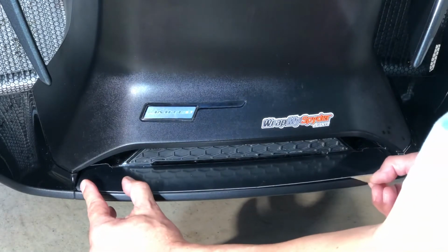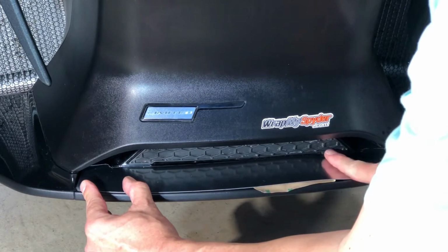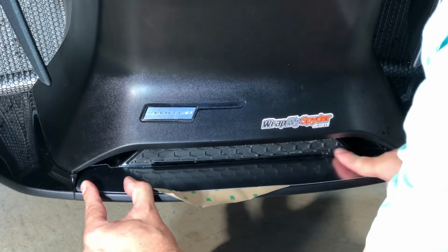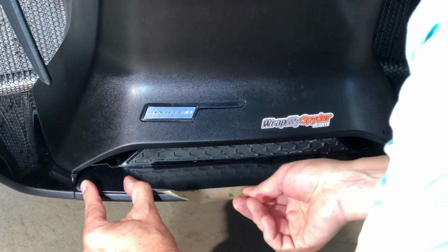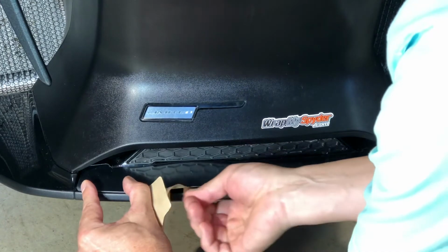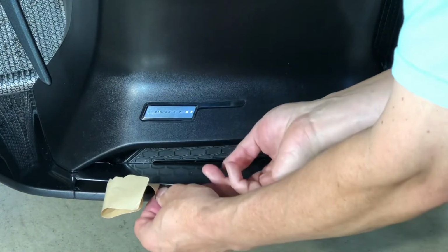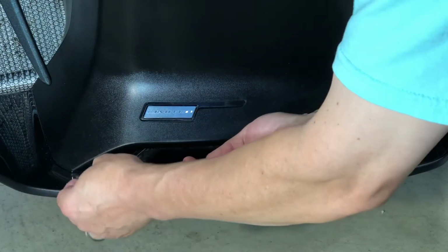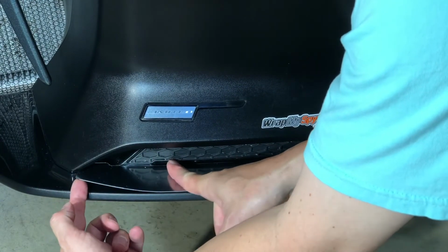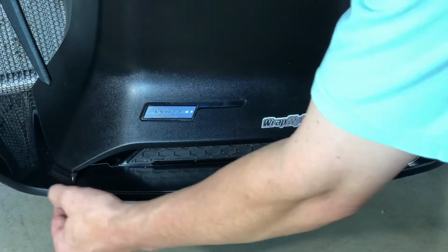And then we're going to bring that adhesive out. Again, pushing it down as we go, slowly moving across the front of the panel. That's going to help so that you don't have any air bubbles and the panel's going to lay nice and flat. Once you get about halfway, it isn't going to change its position. So we can pick it up, keep it in the air, hover, and then slowly work away. See how I'm holding it in the air on the other side? That's again to prevent any air bubbles from getting trapped under there. And of course, it's going to fall right into place.